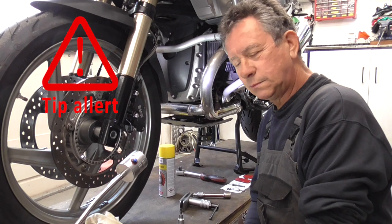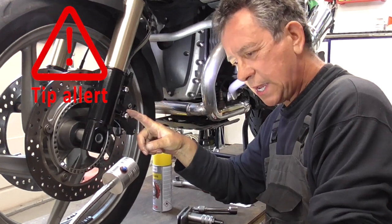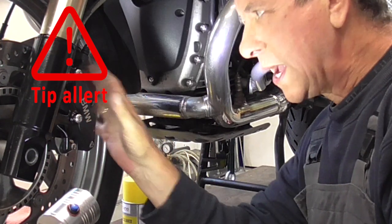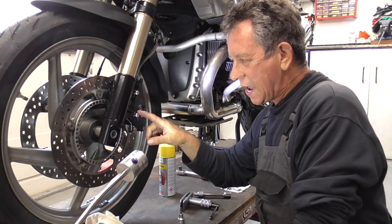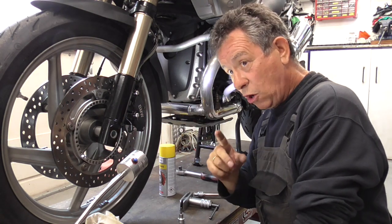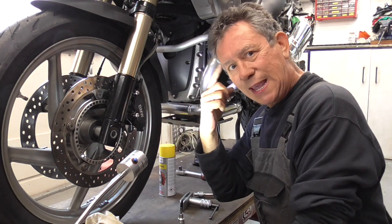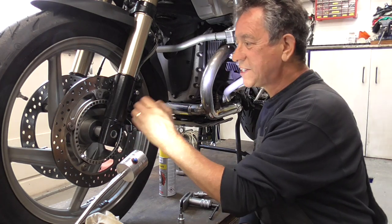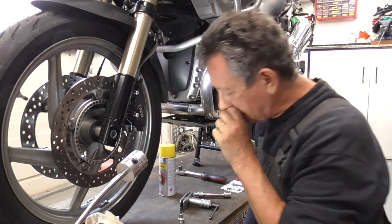What I always do, screw a bolt in, and you need to go on doing other things because I have to slide the pads in. I do not screw them in all the way, because when you screw them by hand all the way and you forget to torque them, you have a problem. And now they're sticking out, so I see instantly, hey, I have to torque them.